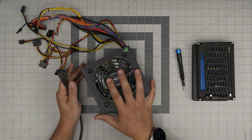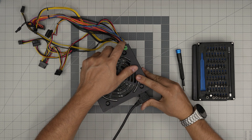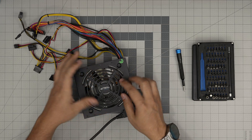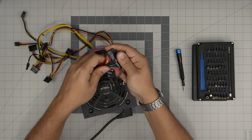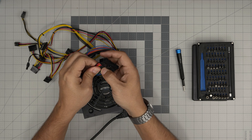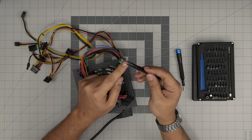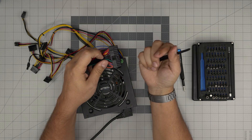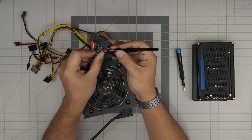Before we open it up, I'm going to power it on — I'm going to plug it in and show you how to test it without connecting it to a PC. I plugged it in and powered it on. This one has RGB on it, yours might not. You want to grab these 24-pin connectors. Yours might be colored like this. You want to grab metallic tweezers that have conductivity on both sides — not a plastic one — or you can use a wire bent into a U-shape to short it out.